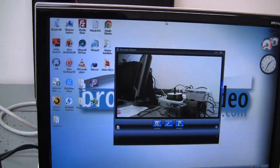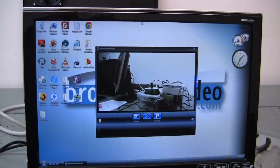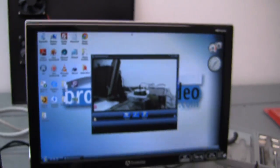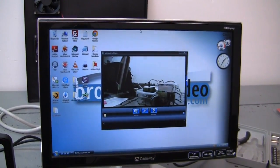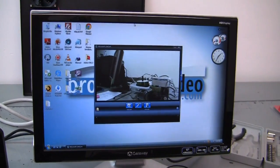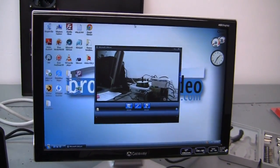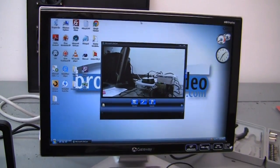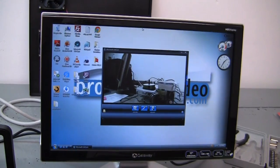This is working fine. Turns out that the majority of problems with the system were caused by a file called applecharger.sys, which comes with a lot of Gigabyte boards. What it does is it allows Apple devices, and I don't have any of those, so I don't know why I would need this, to be hooked up and charge even when the computer's off, but it's not compatible with any of these regular PCI Express cards, so it blows up the world. So if you go in and uninstall the program called On/Off, or go in and mess with applecharger.sys, but if you're in there messing with that, you're on your own. And then everything worked perfectly.